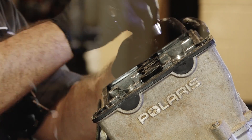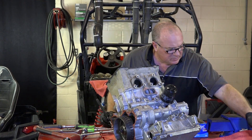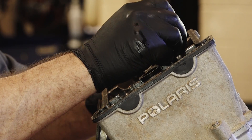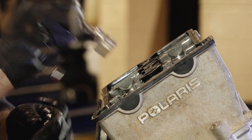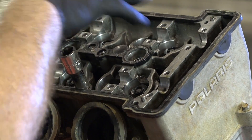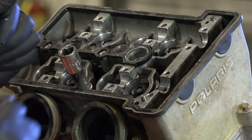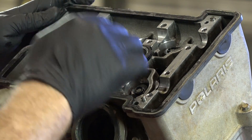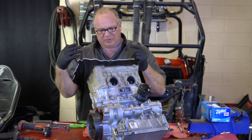Let's go ahead and get the tappets out. We're going to go ahead and take these shims out because chances are I'll end up dropping one and won't be able to find it. Let's go ahead and get this head off. There are six main bolts up top and you've got these two little small ones on the side. The ones up top, you want to take them off in eighth inch turns, and you want to do it in the following pattern: one, two, three, four, five, six. Keep rotating around until they're all loose, and then you can go ahead and remove the head.